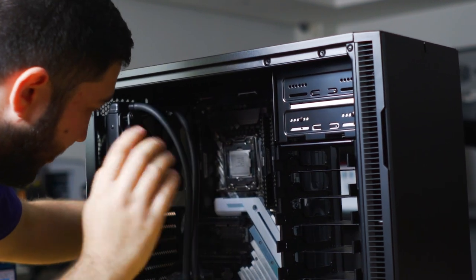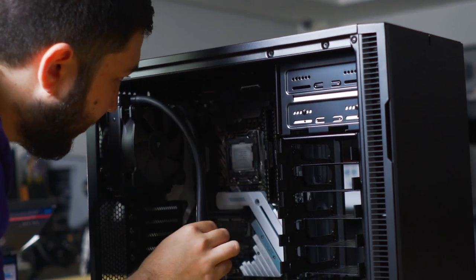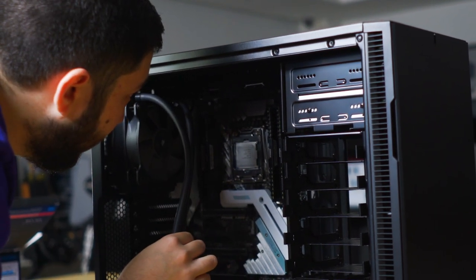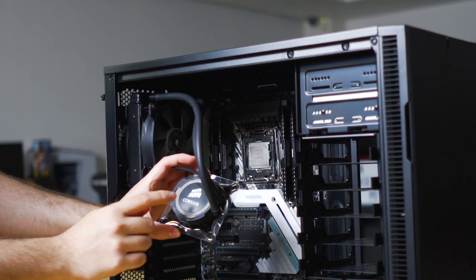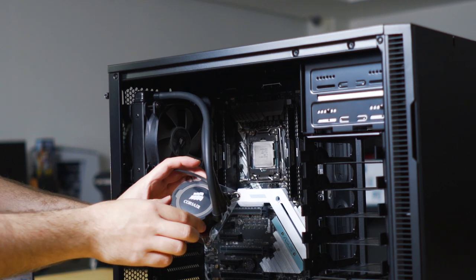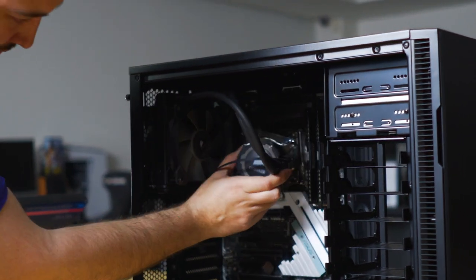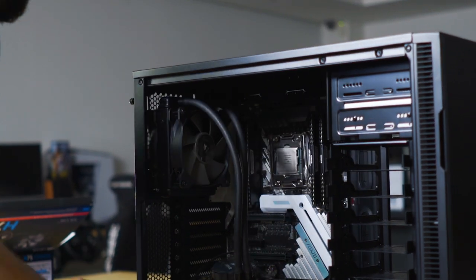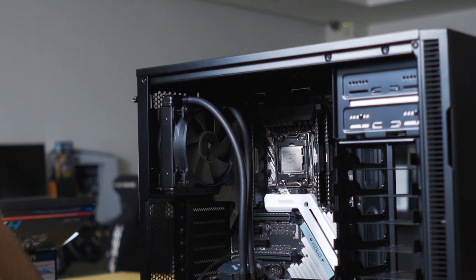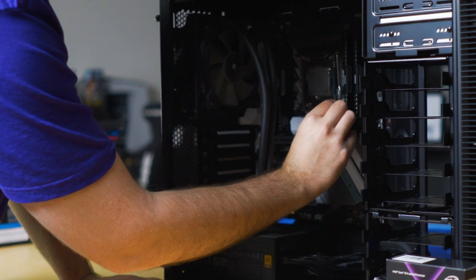Okay, so we have all the cables that we need to power the fans at the back of the system. We should have enough room to access the 8 pins later. So we'll proceed to mount the CPU cooler, or the CPU block head and pump combo, onto the CPU itself. So we'll need these little thumb screws. They'll fasten down on top of this.